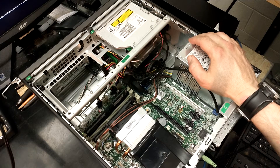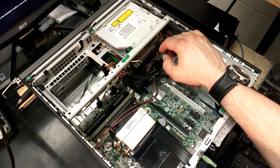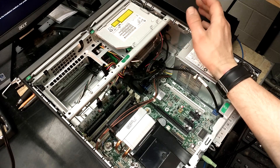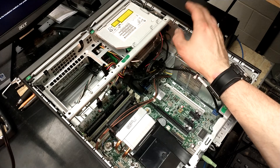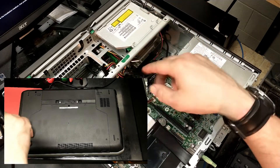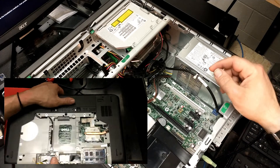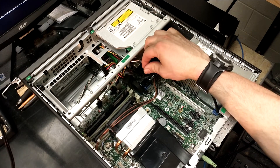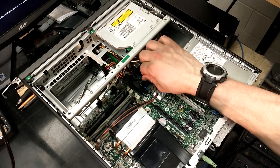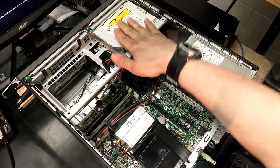This is a big deal. If you have anything installed on the internal hard drive and you do not disconnect it, you will hose the boot — the master boot record will go bye-bye. Your data may not be there if you overwrite it by accident, so you have to disconnect the hard drive. Laptops are fairly easy — usually a bunch of screws on the bottom, pull it off, pull the drive, and start the process. On this desktop, we just have a SATA cable to disconnect. Find the SATA cable, pop it out, and the hard drive is disconnected.